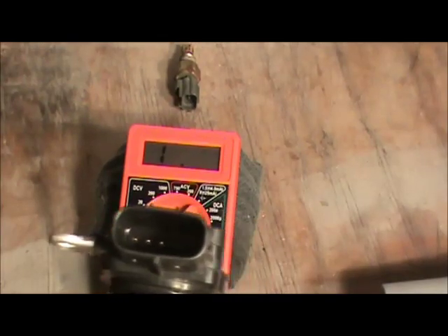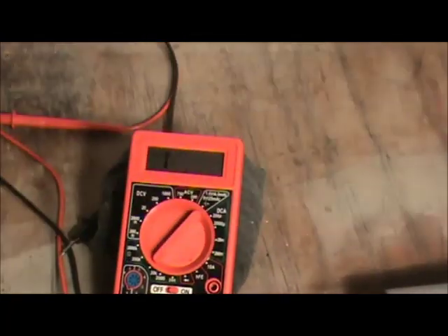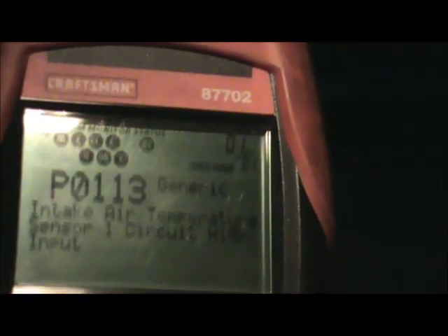The type of diagnostic code you would get if the sensor were out of the picture would be an intake air temperature sensor circuit high. It sees it as circuit high because if anything is broken — whether the ground is broken, the sensor is broken, or any connection is broken — the computer is still sending out five volts and will see those five volts on the signal wire. If it were shorted, the code would be circuit low instead. So circuit high means bad ground, bad sensor, or bad connection at the signal wire. Thanks for watching.